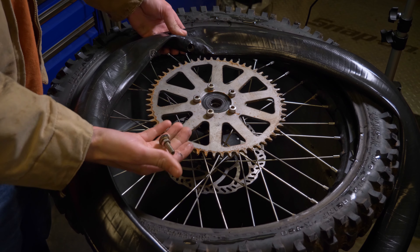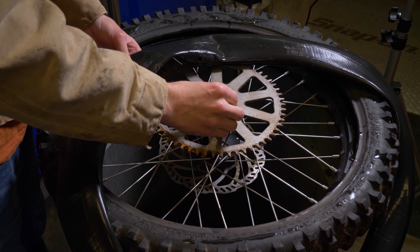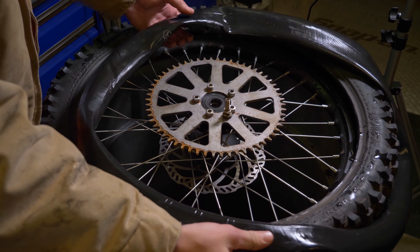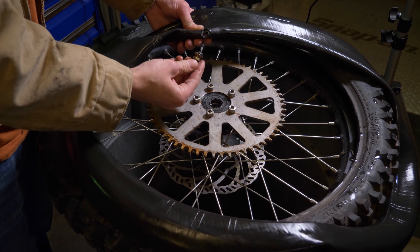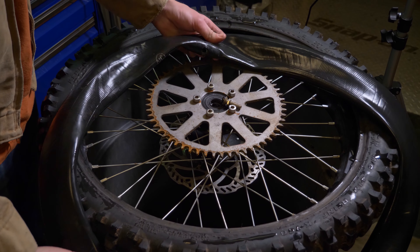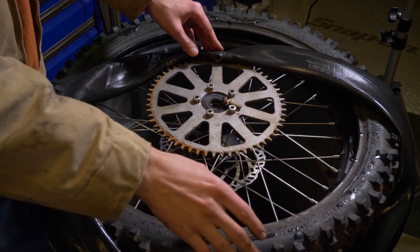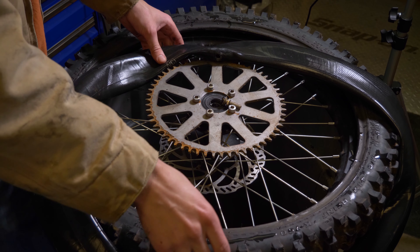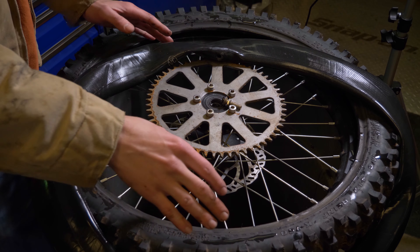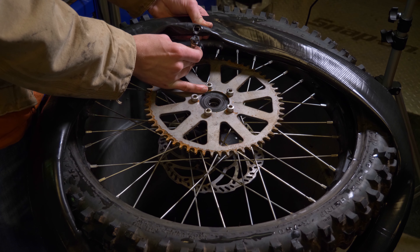I'm going to take the time to examine what caused this flat. Initially I assumed it was a pinch flat, and while that may still have happened at some point — since I was going over some rough terrain pretty fast with a flat tire — the most obvious failure is right there. The reason I think this happened is low pressure, in addition to water getting inside the rim, allowed the tire to slip around the rim. With that slippage, since the electric motor has so much torque, the rim moves faster than the tire, and it starts pulling the tube away from the valve stem and it ripped it off.